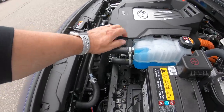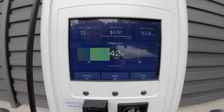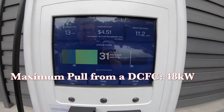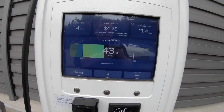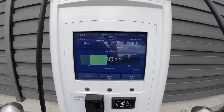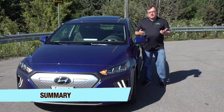After about 13 minutes, it's at 42% and pulling 48 kW — nowhere near the 100 kW claimed by Hyundai on the spec sheet. That's a little disappointing, because they did increase the charging capabilities and I'm at a 350 kW capable station. I really hoped that this 2020 model year with the bigger battery would actually pull more as claimed, but it's not quite delivering on that front.